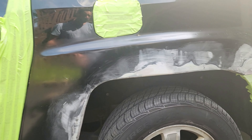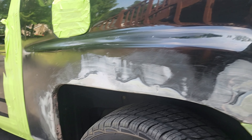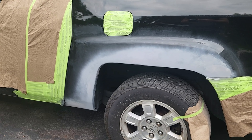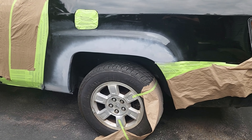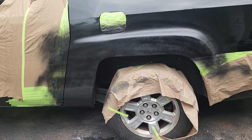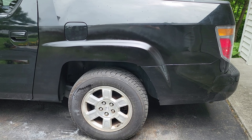If you watched one of my previous videos where I did a lot of bodywork around this fender, you'll see some of the rust still came through — it was more of a temporary fix, just Bondoing it, so I took care of some of that while I was at it. I put the first layer of primer on. It's been drying for a day. I'm going to sand it down a little bit, see if I need any more glazing putty, then wet sand it and paint it. I'm a few coats in, a few more to go, and then I'll do some clear coat. Here it is all painted and clear coated. I'll let that dry for a while and then buff it.